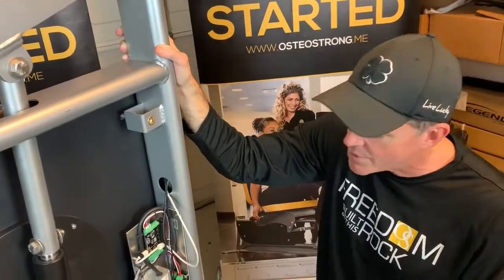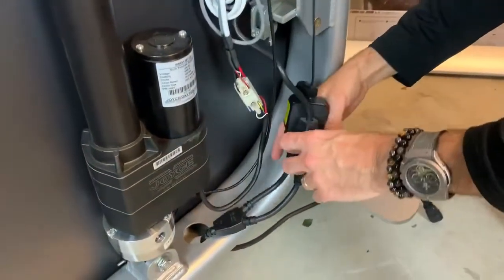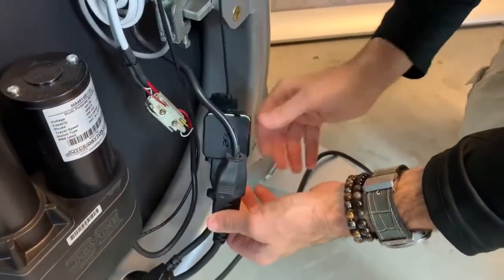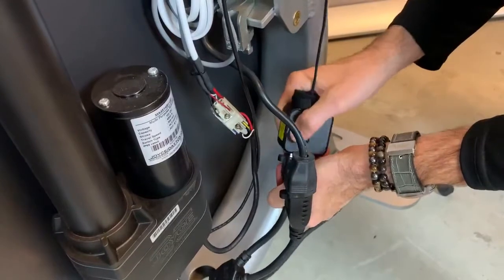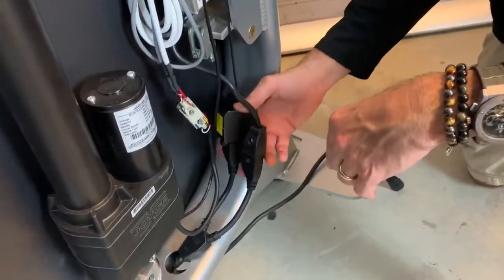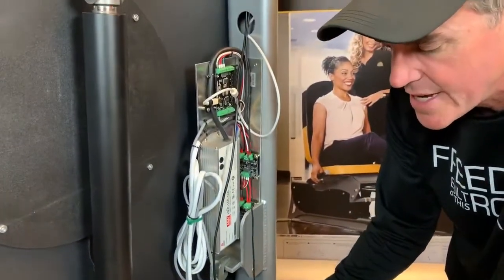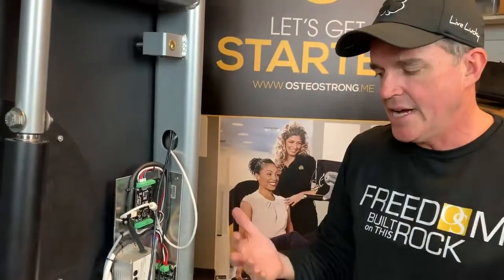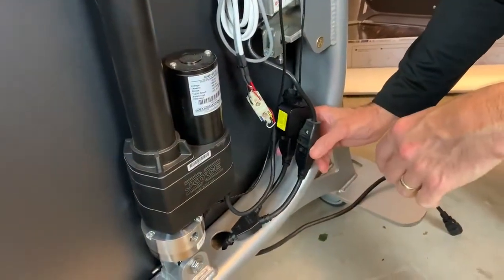Once you have the panels removed, let's take a look inside. On most models you'll have a split cable that comes in for power — these two plugs right here can come unplugged, and sometimes it'll just be partway out, so you have to pay attention and make sure they're seated correctly. This is very frequent, particularly after shipping. Reed usually catches this when it ships — he'll immediately identify and replug it for you and electrical tape it to reduce the likelihood of it happening again.